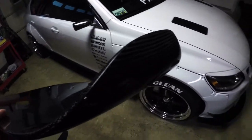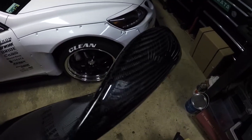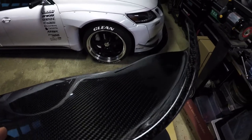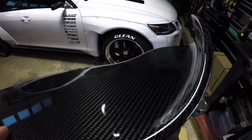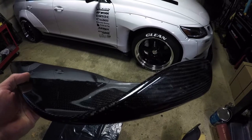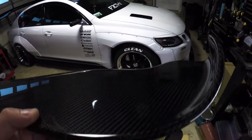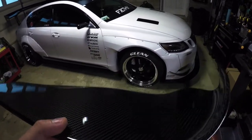We're going to jack up the car. I'm going to screw these in with self-tappers first, and because the holes are going to be there, I'll then put a nut and bolt through the splitter to make it a lot more secure. These are definitely going to add a nice touch to the overall look of the car and widen the front end.